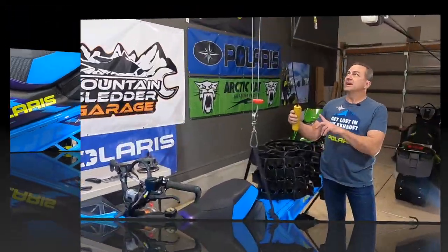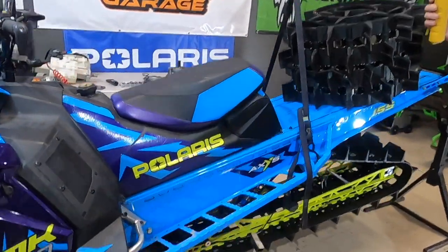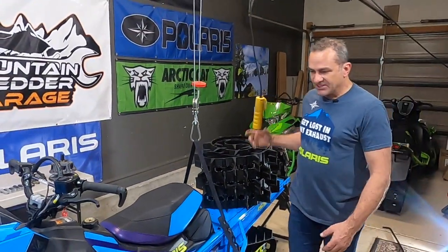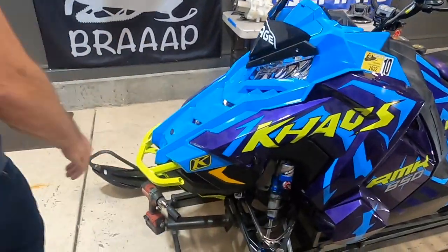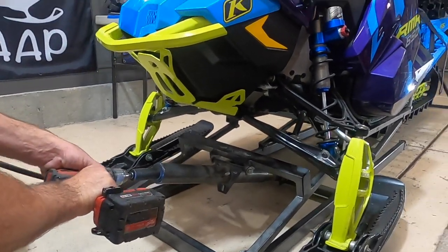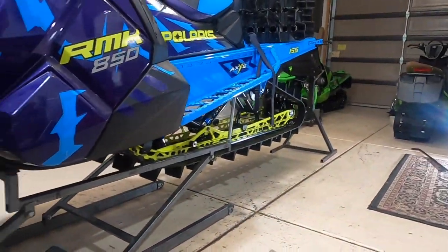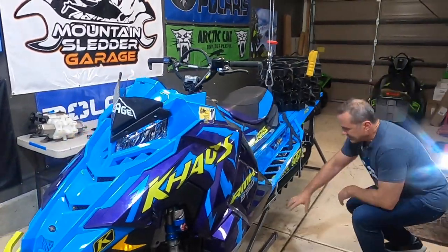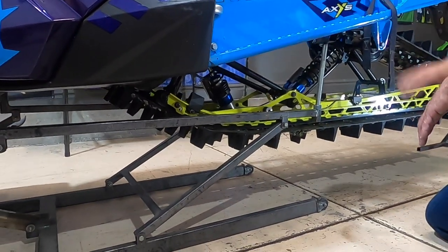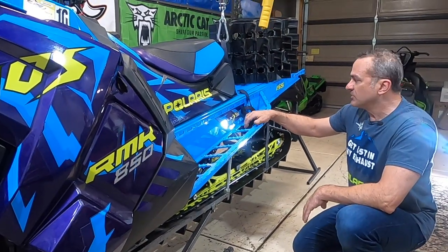I think the footrests are a little more stout. So I have my electric winch — I lift a lot of stuff on this. Let's lift this thing up and get it pretty high off the ground. If you have one of these snowmobile lifts, these are pretty nice to have in your garage. The lifts sit really nicely evenly with the sled all the way off the ground. The only part is when you're pulling the suspension and track out, this part here can kind of get in the way, so I'm not going to use it for that. I'm actually going to use the ceiling method to lift the back off the ground. But those are the three most common ways — you can maybe come up with your own too.